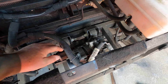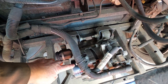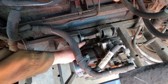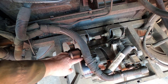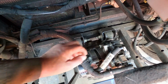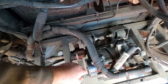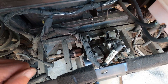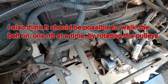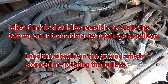In hindsight, I think it might be possible to get enough clearance for the belt fitting by taking off the two bolts out of the top mounts — the two bolts that bolt that bracket to the top of the differential. I think then there'll be enough room to slide the motor further down. Because at the moment the motor hits against there. I think there'll be enough room to tilt the motor over and get the clearance to get the belt on without taking the pulleys off. Just my theory, but I think that's possible.